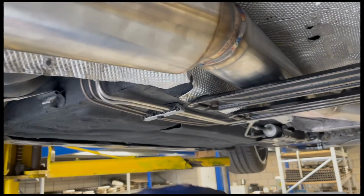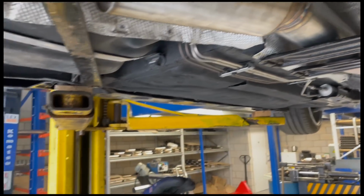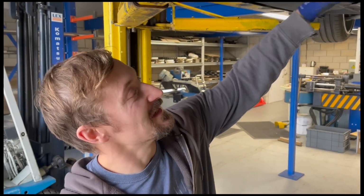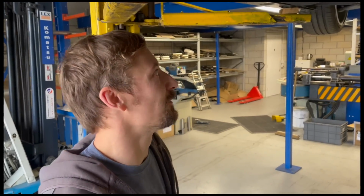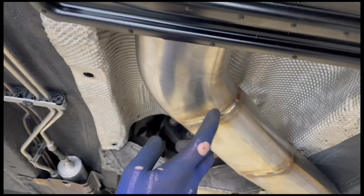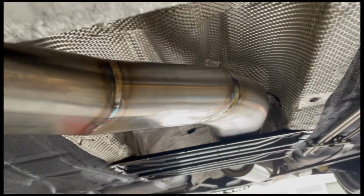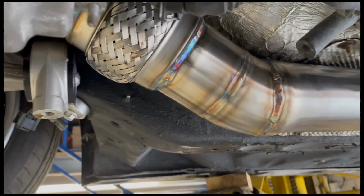And then it's 3.5-inch all the way. So you've got the silencer. Is the oval, do you make the oval, or do you buy it in? No, we buy that in because it's so ovaled. It's like 2.5 inches high. So it's not very tall, and it's so squashed that to get it done nicely, you're better off just buying it. So we've got the Vibrant oval. Oh, it's the fancy Vibrant as well, with mandrel bends. Nice. That's really cool, because I make mandrel bends, but the idea of doing oval ones is totally foreign. It's quite a thing, isn't it? Yeah, but it's much nicer than doing it with pie cuts, and takes half the time. And then adapt it back to round, and so we've got a flexi on there.